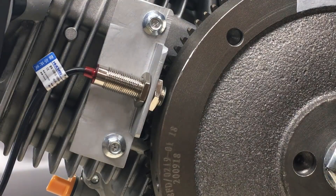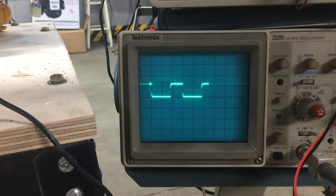And yeah, that's a huge problem. You see, on the oscilloscope we would get a signal like this, and that's not cool. The ECU is expecting a signal like this.